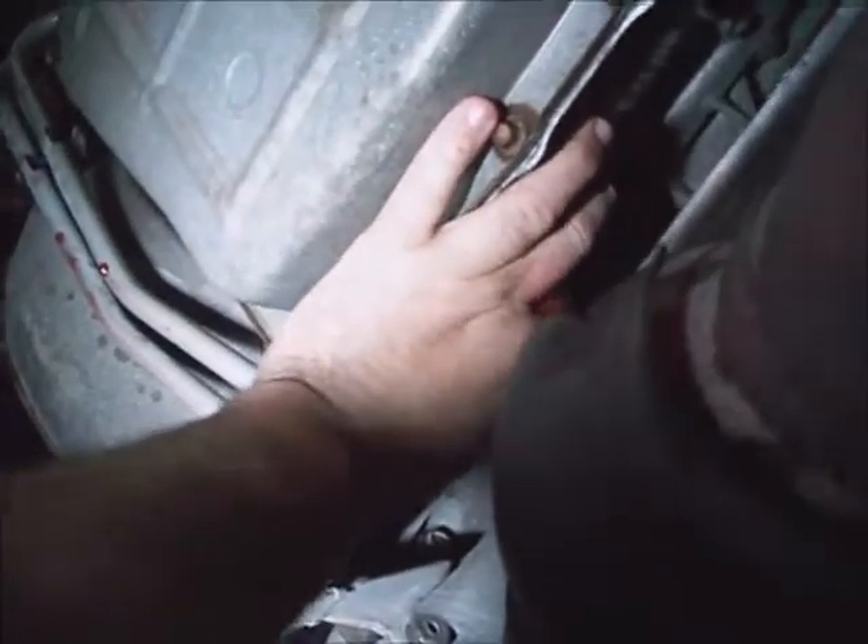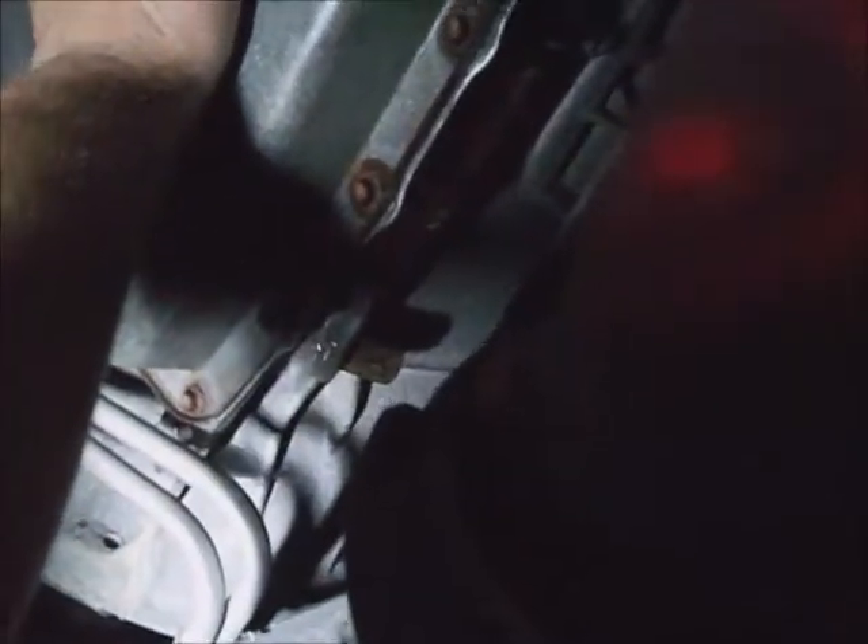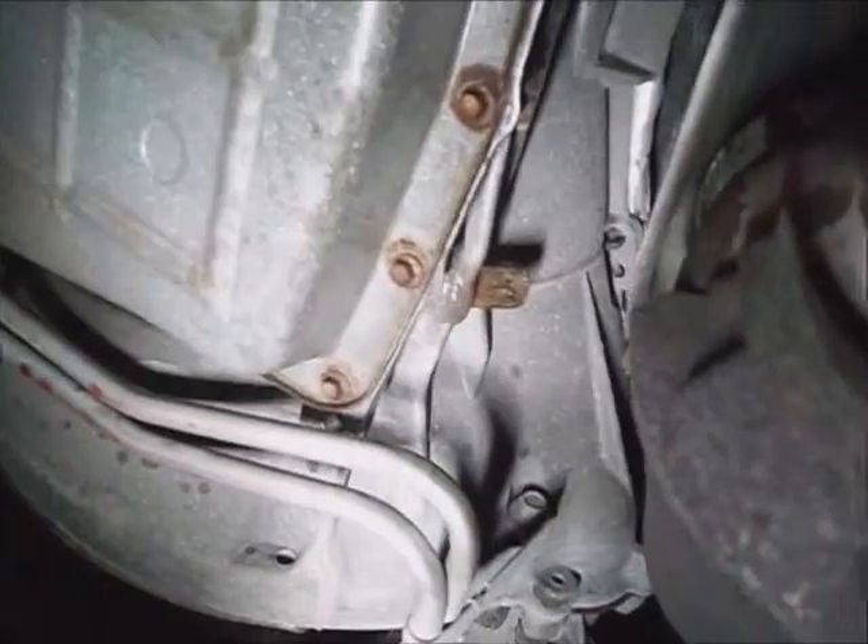Snug it down — it's starting to get pretty hot underneath here. Steer clear of that catalytic converter; it'll cook you. It'll be a good place for a fan to be running — keep your hand away from the exhaust, which is 500 or 600 degrees. Don't turn it off when it's filled up or fluid will shoot out. Take a 19mm and snug that plug down.